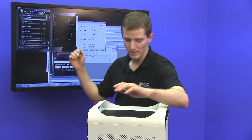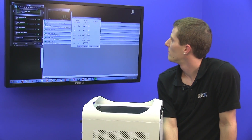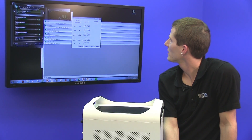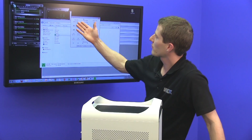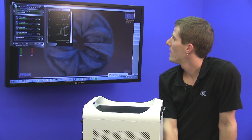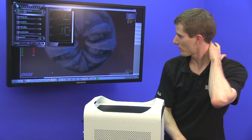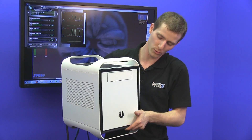Now it's time to talk temperatures. The idle temperatures are alright, sort of in the 30s — though I'm not quite sure whether to trust those. But as soon as we load it up, we're only about 55 to 65 degrees on the CPU, which is overclocked to 4 GHz. I made a mistake earlier where I said we were using a 3770K — this is actually a 3570K, so that is an overclocked temperature to be very clear. Now we're going to load up Combustor and see what we get on the GPU. To be illustrative: it would be normal for a GTX 670 to run at anywhere from 85 to 95 degrees under load, especially in an ITX enclosure — this one is running at 44 degrees. Thank you for checking out this episode of NCIX Tech Tips, don't forget to subscribe, and hopefully you guys build your own sweet little liquid-cooled Prodigy like this.